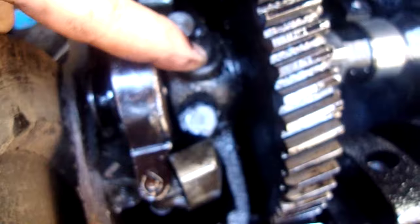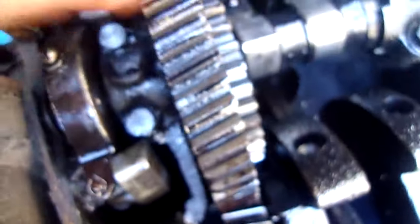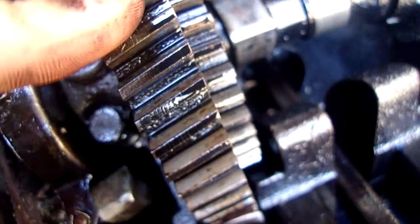I think a gasket might be dead, I'm not sure. Seems like there's a lot of extra chunks. That's sad. I might just go with it and see what happens. If it starts leaking a lot of oil, we'll know it don't work. Look at the little piston too, it's so tiny. But yeah, it's got the two bearings for the cam with little oil catchers on it. A cool thing I just noticed is it doesn't run the... Wow, there's a chip on that. Oh, that's the timing chip, never mind. But the cool thing I noticed here is it's got the cam gear and then it's got the gear for the mag, so that's kind of cool.